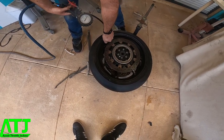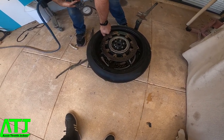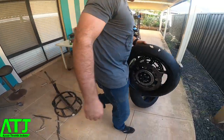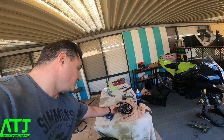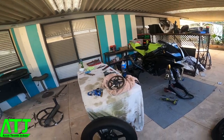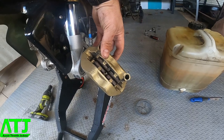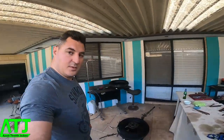Once that's done inflate it — I need about 33-35 psi for tomorrow. One done. While you're doing this it's a great chance to take the chain carrier off and give it a good clean, make sure the gunk's not going all over your chain. Also while your wheels are off have a good look at your brake pads — they've probably got at least another day or two in them, but I've replaced a couple on the other side already.